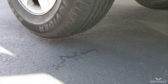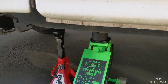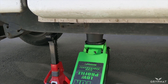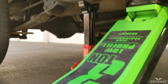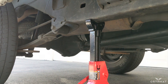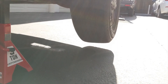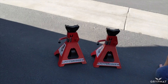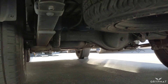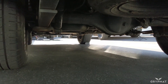We've got both tires off the ground. Even though the jack is back here it lifted up over here too — on a frame like this, that's all right. So now that we have everything positioned, we'll slowly lower the floor jack onto the safety jack stands. Passenger side is lifted. You would do the same exact thing for the driver's side and then you'll have all four wheels off the ground. Now that we have the front tire chalked for safety, we're going to lift the back half of the car from the differential.